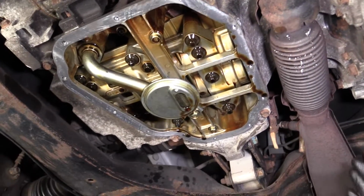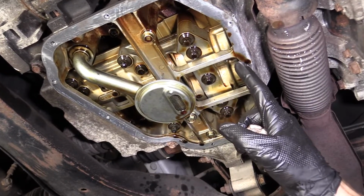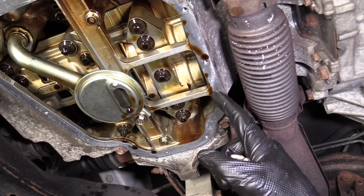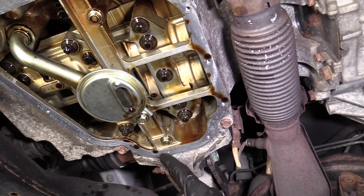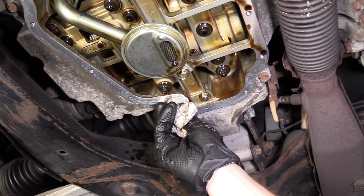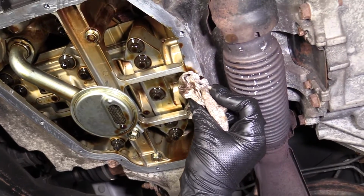Okay friends, so we just walked over with our oil pan. We need to make short work of this discussion real quick. We're gonna clean up all this oil, because if we don't, this is where our new oil leak's gonna form, because the gasket's not gonna seal up against the engine in between the oil pan and the engine, all right? I'm talking a little faster because we have RTV drying on that pan right now. You really only have like a 5-minute window.